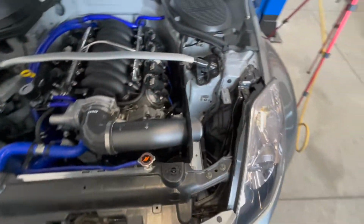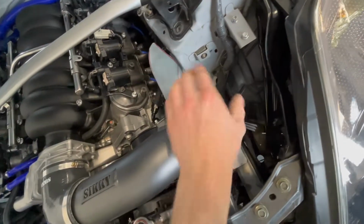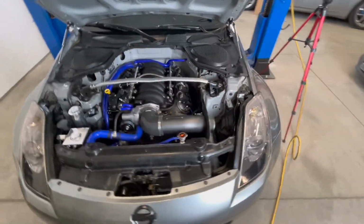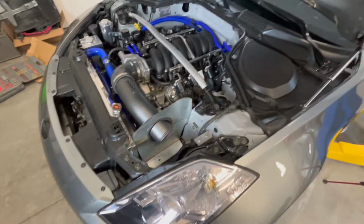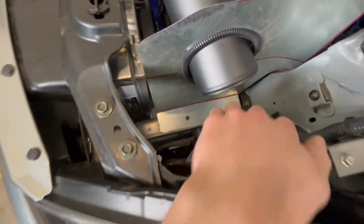This is what I've come up with, version 1 of this heat shield here. It doesn't look too bad actually. I put some loom around the hole where it comes out, and then I'll put some loom all the way around the top and then down here as well. And then obviously I'll paint it black, but as you can see, it's not too bad. It cups around nicely there. And like I said, this will get all nicely sanded, and it'll bolt. There's actually a bolt right there where I drilled the hole. And then that keeps everything separated from the engine bay on this side.